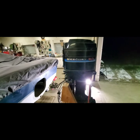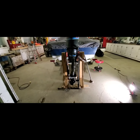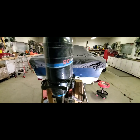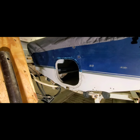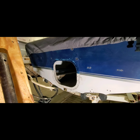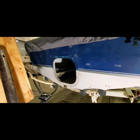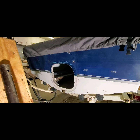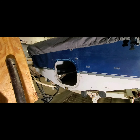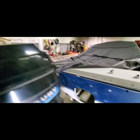This Merc is in pretty decent shape — it's not huge horsepower or anything, but it'll do. Originally I think it was a 3.8 OMC. From the research I did on the internet, there was a 3.8 OMC V6 engine in here, came with an OMC leg. I can tell by the size of the opening here — this boot. There's not too many with that same size; they're almost always 3.8 OMCs.